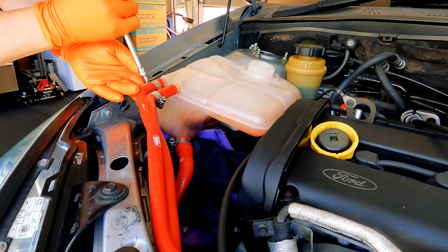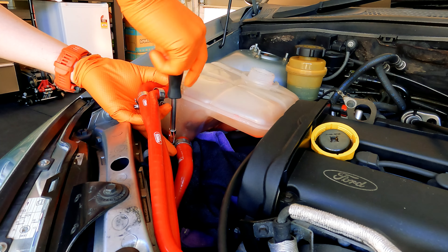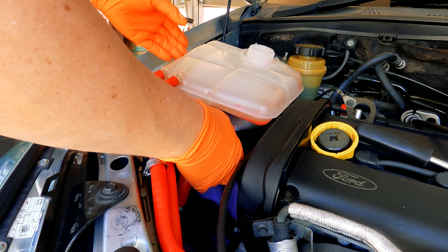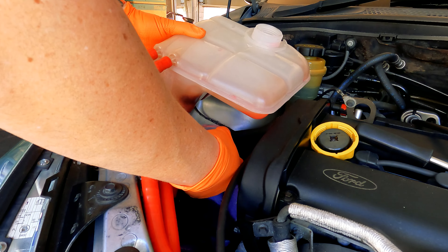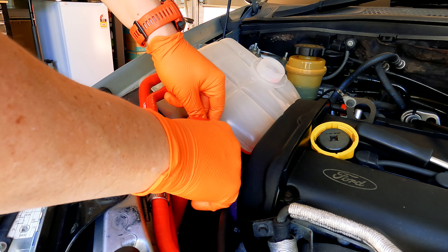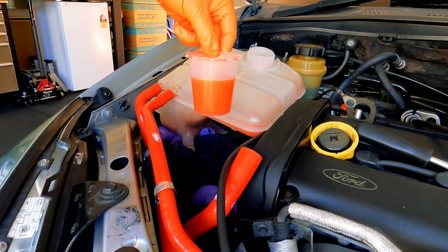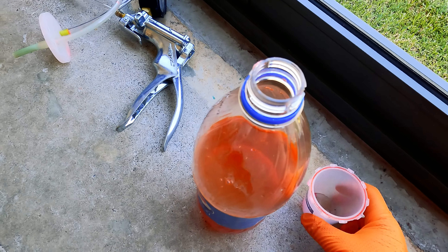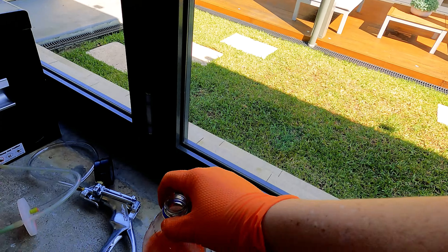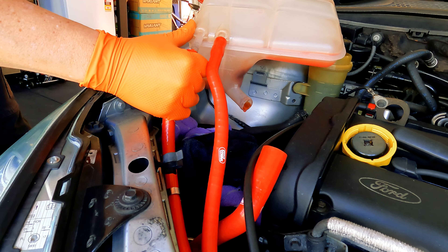You've got two hoses up the top and one just underneath. Get that loose, get the clamps out of the way, and crack them off. That's how much coolant is left in the expansion tank — just pop that in the bottle. If your coolant's in good condition you can reuse it, which mine is. Really all you've got to do now is undo these two hoses — that's one, two. Coolant bottle is off.